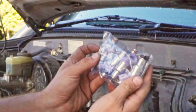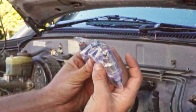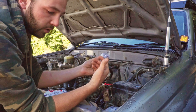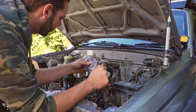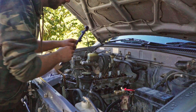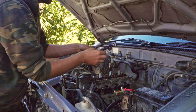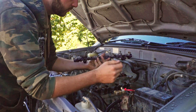We're going to get rid of those and instead we have our brand new 750s going in. These are going to be lovely and squirty, giving us just the right amount of fuel. Plus with the ECU we can adjust how long they stay open and everything in between to really get this running perfectly — fingers crossed. After you remove your fuel rail from your line, she's going to seat like this. Once you pop it out, your injectors are sitting in the four holes — you just go through and yank each one of them out, clean it up, good to go.